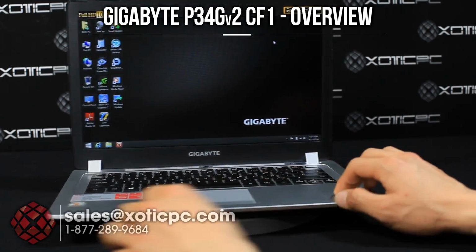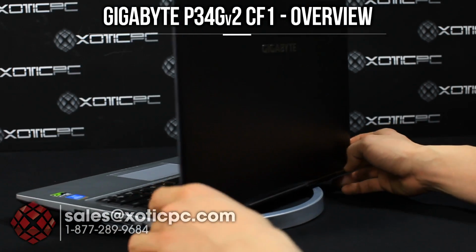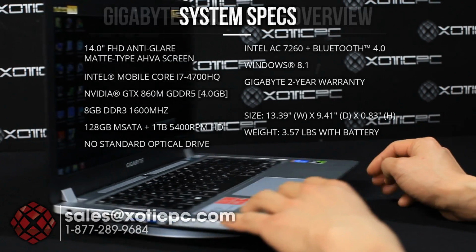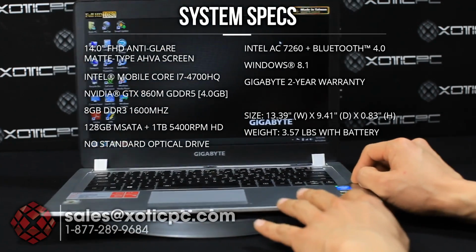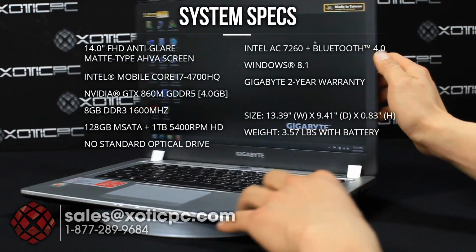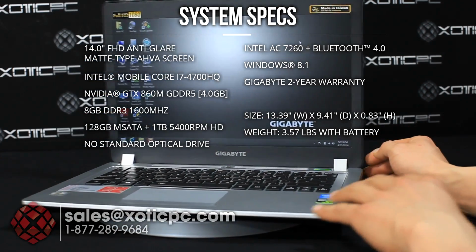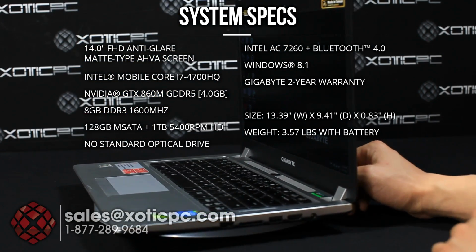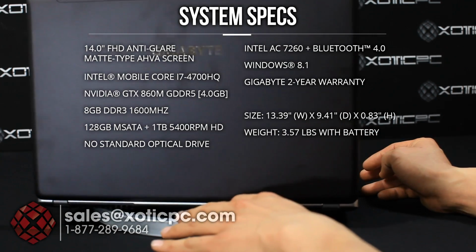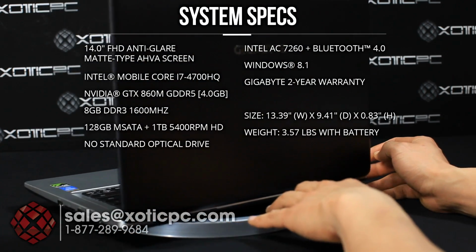Hi everyone. Thanks for checking out XOTIC PC's video review of GIGABYTE's P34G version 2-CF1. This is going to be a 14-inch computer. It's a 1920 by 1080 screen, and it is an IPS matte type anti-reflective screen. So it's IPS type, gets you very good viewing angles. For the hardware, we're looking at the 4th generation Intel i7 4700HQ 2.4 to 3.4. Now the HQ CPUs are not upgradable. They are integrated onto the motherboard, so we cannot put any other ones in there for you.